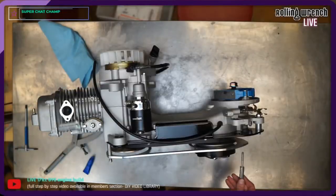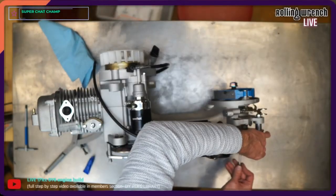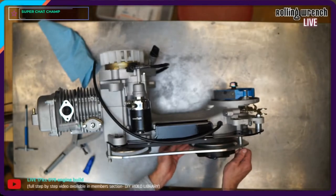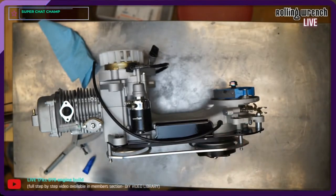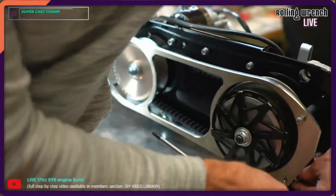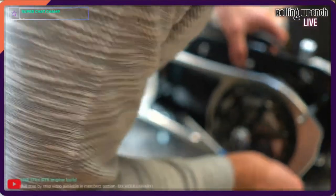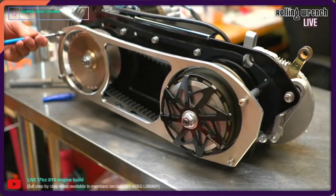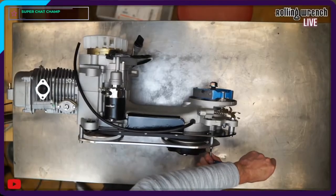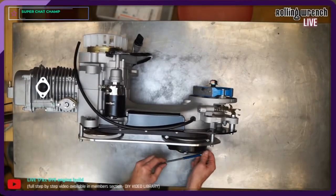We're gonna go up the top right here. Get this back piece set first. You'd be having a pain in the butt lining all this up. But lucky for me, I'm a freaking professional and I know what the frickin' do. Now I'm just gonna go in a star pattern here till we get it. 9 foot-pounds, don't have them come loose.